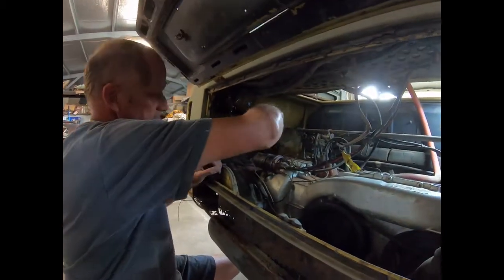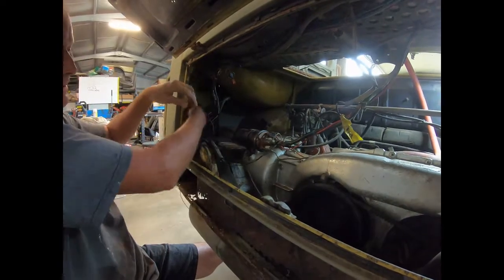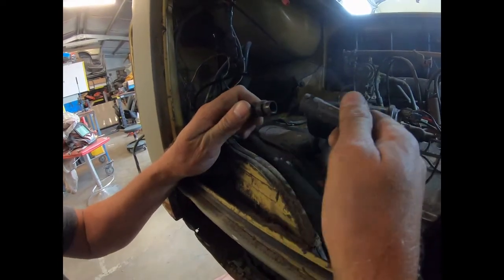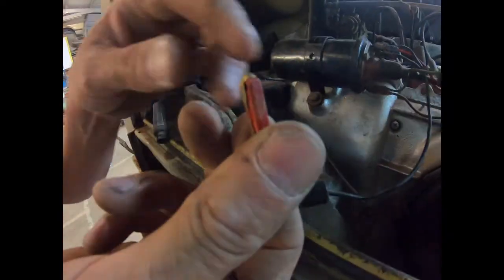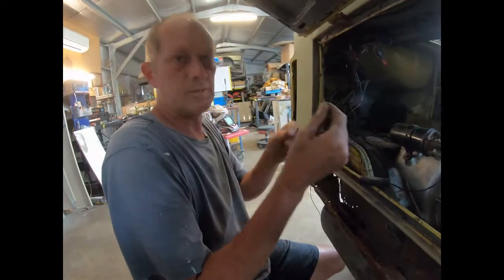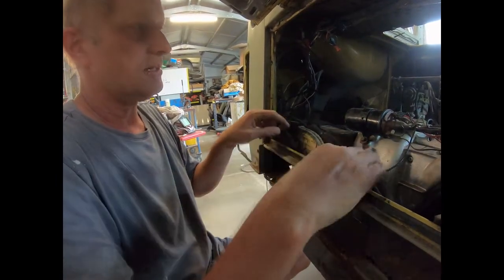So this had a second battery, so there's obviously going to be a little bit of extra wiring for that. So it's a matter of tucking that out of the way. But you can see here is a fuse. It's one of the old school metal fuses, I think. Don't have any glasses on, but it looks all right still. I'm pretty sure this is to do with the reverse lights, because we had troubles on a customer's car when we put it all back together and the reverse lights weren't working. It just turned out this wasn't connected.